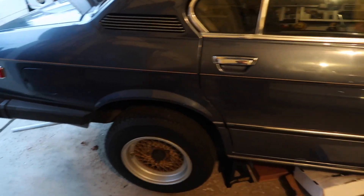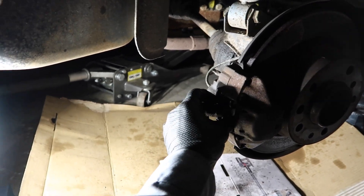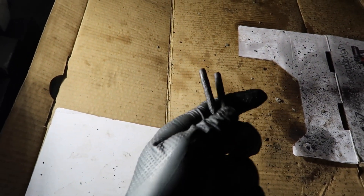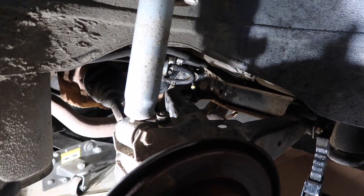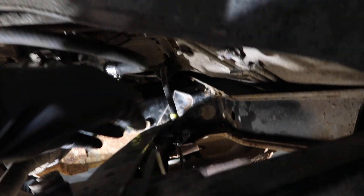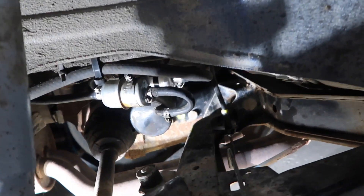While the front caliper soaks, I figured I should check the rear. As you can see, the rear rotors do not spin whatsoever — they are very seasoned. The car's e-brake is down and it's out of gear. I've never done a full refresh on brakes like this, and it's really satisfying to have fresh-looking stuff. I want this car to be 100%. In the rear it's the same setup as the front — two pins, anti-rattle clip, and the pads slide out. The rears though are much more rusty, so I really had to punch them out with a hammer. I don't know why these old BMWs route things this way. Normally you'd have the hard line going to a soft line into the caliper, but these cars put the soft line at random spots. Here's the rear soft line tucked way up above the subframe — kind of an obnoxious spot.